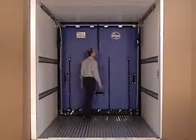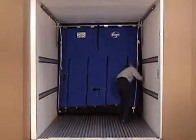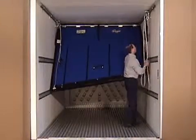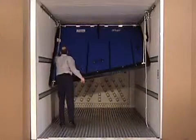Remove the ropes from the rope bags. From the curb side of the trailer, use the lower handle to begin to raise the bulkhead while pulling the slack on the rope through the lift assist pulley until the bulkhead is waist to chest high. Make sure the rope is secure in the lift assist cam cleat.